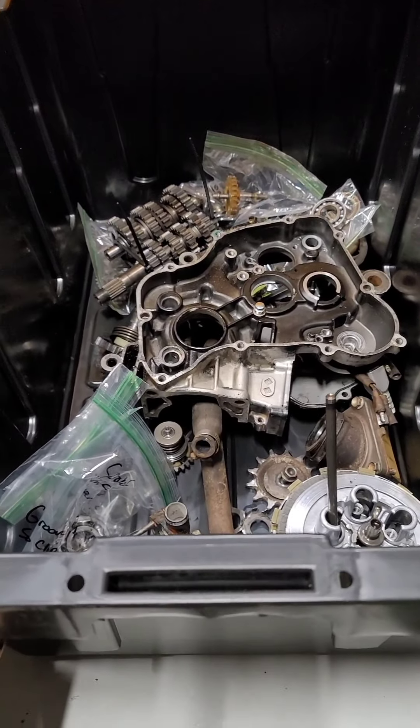Check your brake pads and clean your brakes very well. I take my brake calipers off and use my sandblasting cabinet with glass bead media — it makes them look nice and fresh and cleans all the crud off. I've replaced my brake pads and brake lines with Galfer brake lines and pads — they're top quality and they always seem to have lines to fit your bike no matter how old it is. Highly recommended.